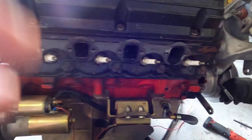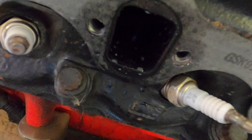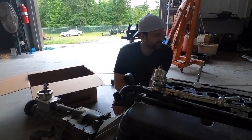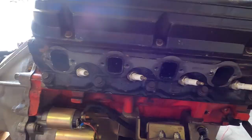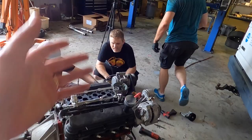Still working on the tear down here guys but check this out — those aren't supposed to be in there. Got some coolant in there — condensation and coolant. Tar Heel Fox is all over that coolant in the cylinder. You've got it in the crankcase — yeah that's even better. You've got coolant getting into the crankcase somehow. Yeah you can hear it drip — when you shut my car off you can just hear it go bloop right down. It's not bad enough that the oil is milky, just bad enough that his engine smokes and you get that little bit of emission. I can drive a little more and make it get worse I think.